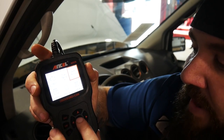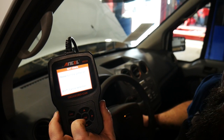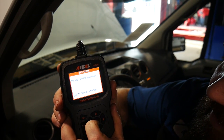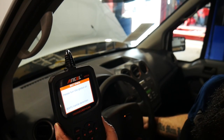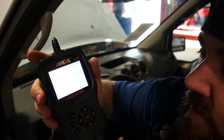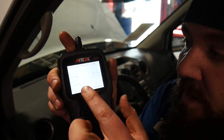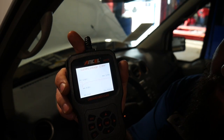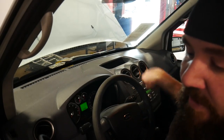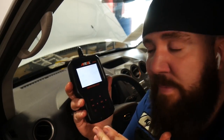The cool thing about this one is it does have a battery test. You click on it, it tells you to turn the ignition off, start the detection, hit enter. Then it tells you to turn the ignition on. Once you unhook it, you can see the voltage — it's going to dip down and then max back up to 12 volts. If you're doing a charge system test, that would show exactly what you want to see. It doesn't give a simple pass/not-pass result for the battery and charging system, but it does have the actual graph so you can see exactly what the system is doing.